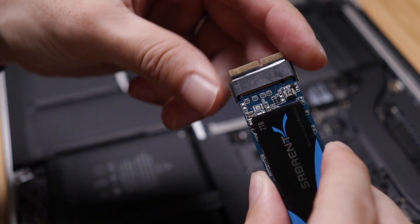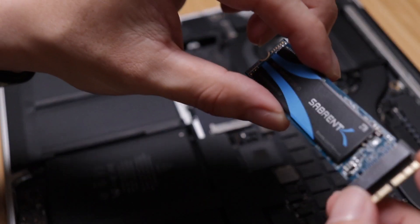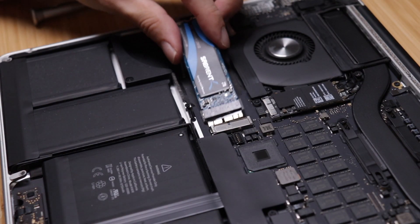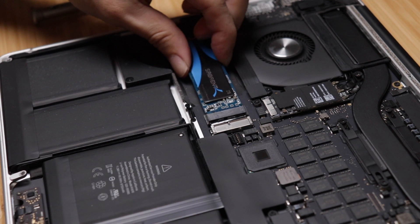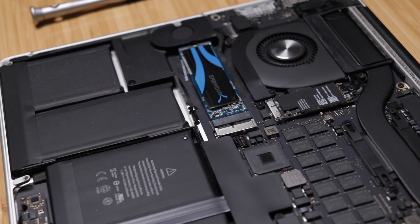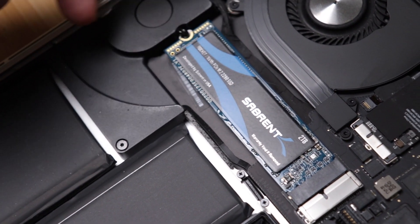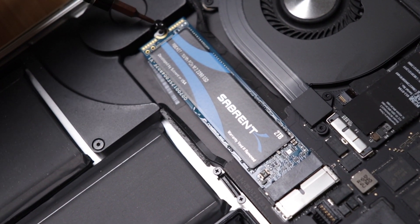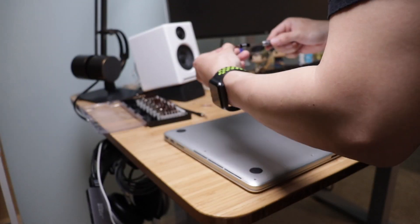Now, the brand new M.2 NVMe SSD doesn't work right out of the box with the 2015 MacBook Pro. To fit this in, you need to plug it into an adapter that you can buy on eBay or Amazon for maybe $15, and that should allow you to plug in the SSD really easily — you just slide it in and it works. One thing to caution against is that there are many Chinese companies that manufacture this adapter, so I will include a link below for the specific adapter I used so that you know it will work for your 2015 MacBook Pro.